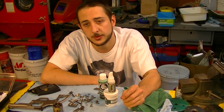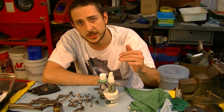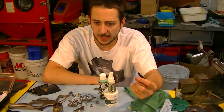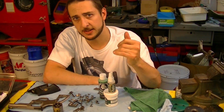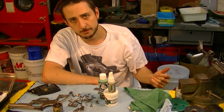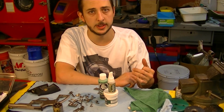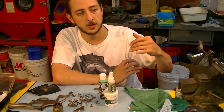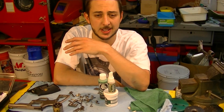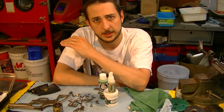Most of those ovens, once they get to their temperature, will not read any higher than the set temperature, so you don't see that fluctuation. Once they have gone up past it, they pull power and go back down past your set point again until they say, oh, we need to give some power again. It's going to fluctuate like that for a little while. It's going to take a good 45 minutes to an hour for it to even normalize.